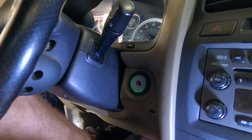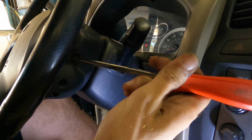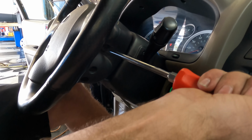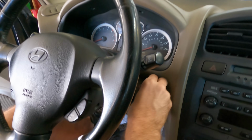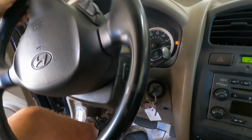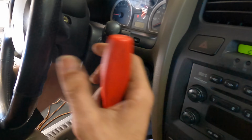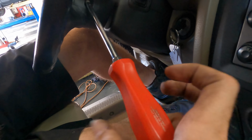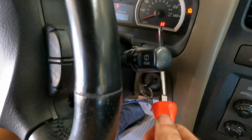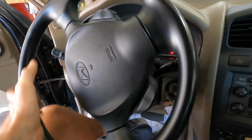Okay, let's move over here. Let's re-screw our screws. Gravity. Flashlight gravity. Click. Starting the engine. Haha, I gotcha on that one. That was awesome. Okay, let's rotate this around. We've got the one finalized screw, last one right there. And then I'm gonna bust out the scan tool and clear those trouble codes for that SRS light, that airbag warning indicator right there, and see if that deployment loop trouble code goes away.